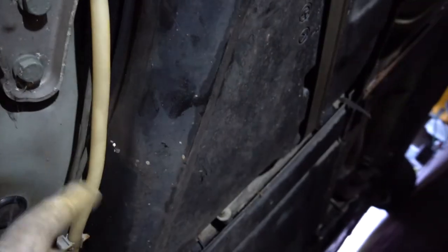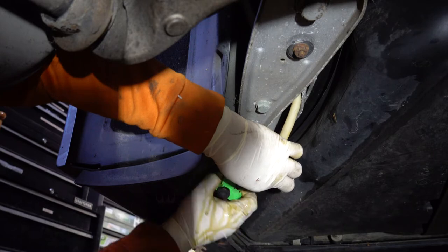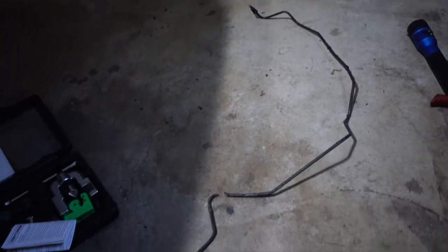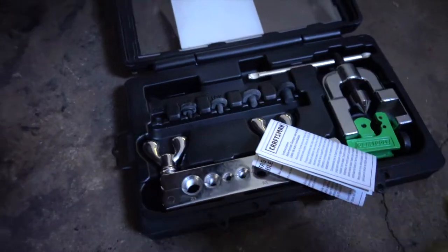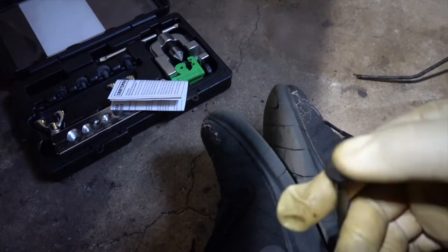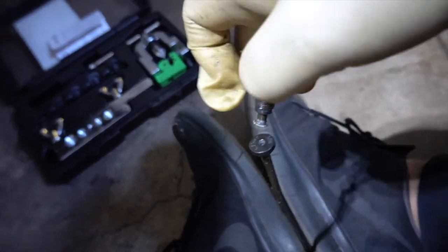So let's cut this and measure what type of brake line we need and go get it at the store. I cut it with aviation snips and had to straighten out a bend. With about three or four feet we should be safe. I know it's 3/16ths because that's the only adapter that fits. I'll make the flare with the tool, match it up with a fitting, and put a union in between them, with the appropriate fitting on the end going to the rubber hose.